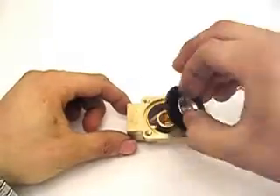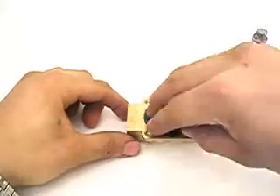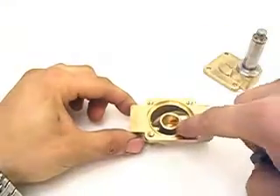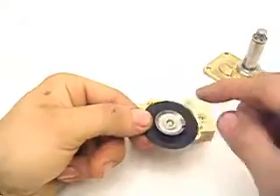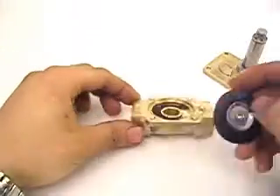Now this works against you whenever your tank pressure drops. What happens is when you lose tank pressure on this side of the valve, the air is removed off the head of the valve. You now have, let's say, 50 psi pushing up from the center of the valve on this small orifice here. Now there's nothing on top holding it — it lifts this up, forcing air back into the tank.